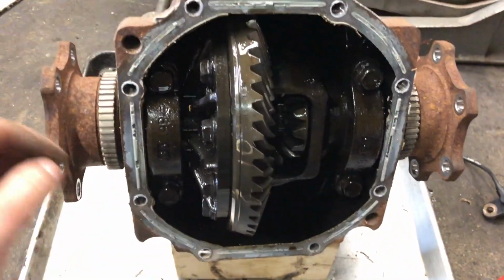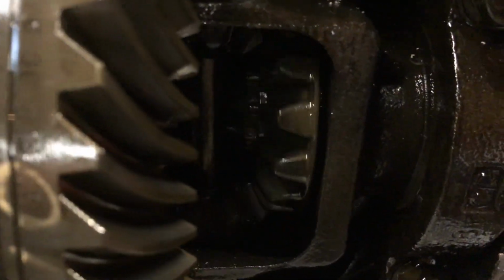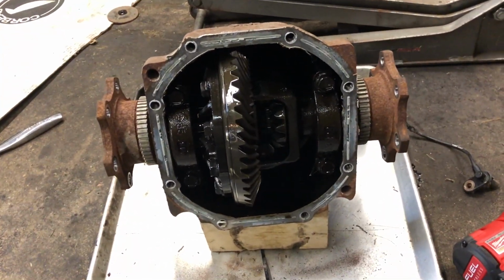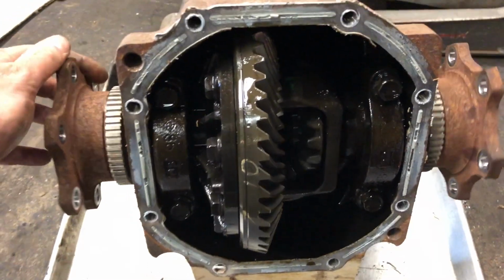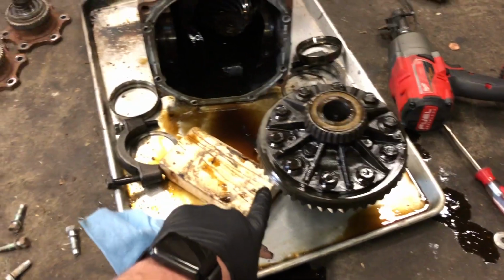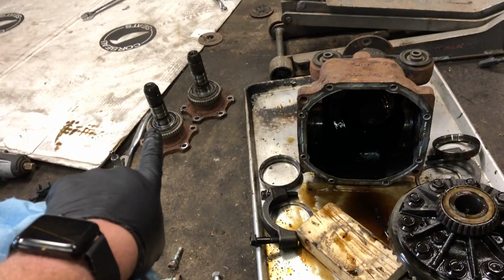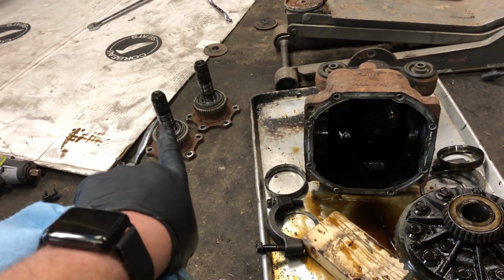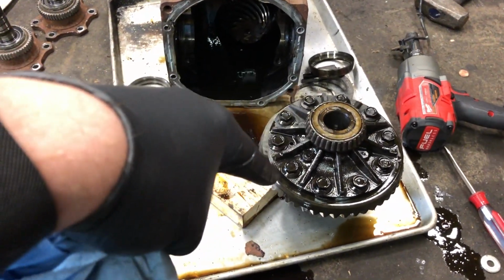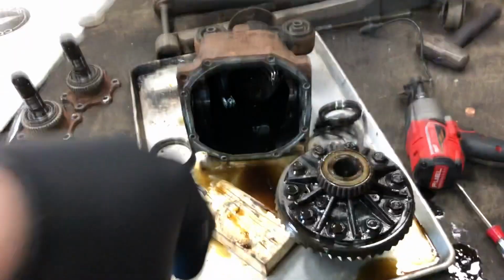So I went and got the cap open. Ooh. Okay, sorry, it's just disgusting. Open diffs are gross. Oh man, I can't believe I've waited this long to swap this. So bad. So I got the actual unit out of the diff and all the spacers, make sure everything stays on the right side. I won't be using those axles because on the VLSD one, it's longer. So I gotta pull this ring gear off, swap that ring onto the VLSD, and then reassemble everything.